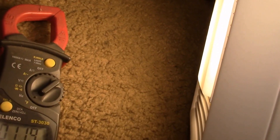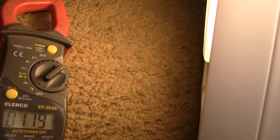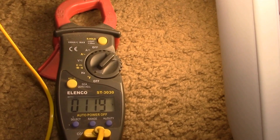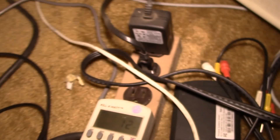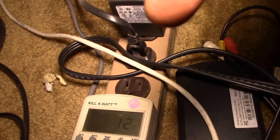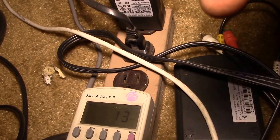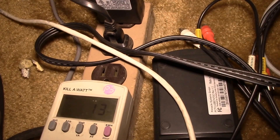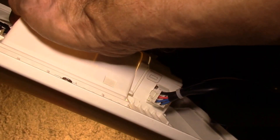I've had this 8-watt GX24 lamp running for about half an hour and it looks like it's topping out around 120 Fahrenheit. The watt meter is showing about 12 to 13 watts, but this meter tends to read about 5 watts high at the very low end, so the power is probably 8 watts as specified.